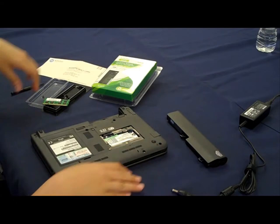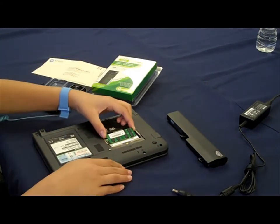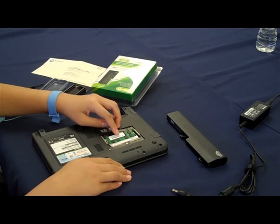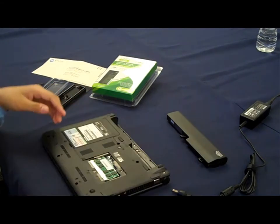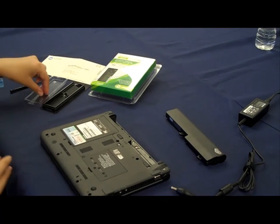Next, just insert the new WinTech Value Memory Upgrade Kit into the memory slot, ensuring the pins align with the pin connector. Then, restore the compartment cover by screwing it securely into place and reinstall the netbook battery to power up your netbook.